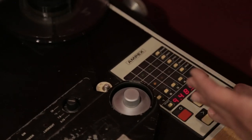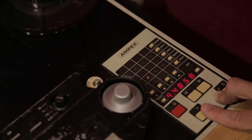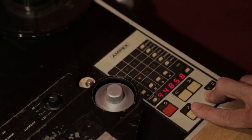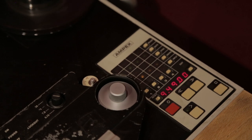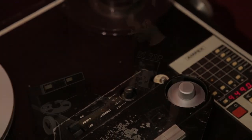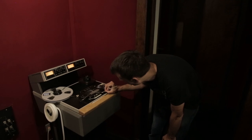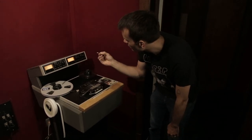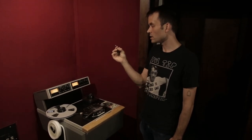Now that we've arrived at the very inside of the reel, we're going to play a short section and then again clean down the heads with isopropyl alcohol, looking out for sticky tape particles that have come off on the heads. After playing back that inside section, wipe down your heads one last time and check your q-tip for any discoloration or tape fragments. If you see anything on the q-tip, it's time to bake the tape; but if the q-tip is clean, you can go ahead and transfer the tape.